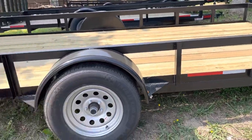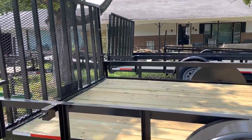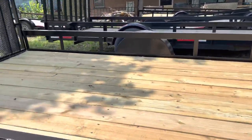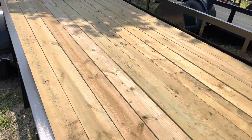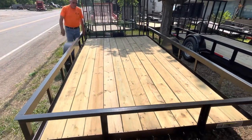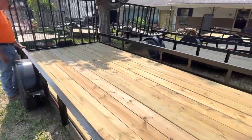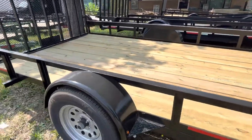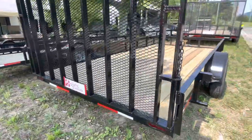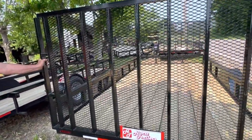We use a 3x2 angle top and bottom rail on everything except five-wide trailers. This trailer is seven wide — it is actually 84 inches clear inside. You can look at our trailer and you can tell the difference in the width without a measuring tape. This one will have 11 boards in it, which ends up being 84 inches. The trailer has got an extension on each side of the gate, which accommodates the extra six inches.